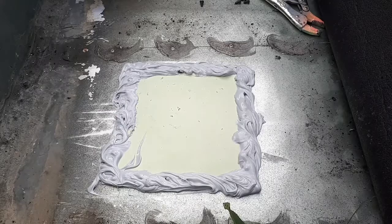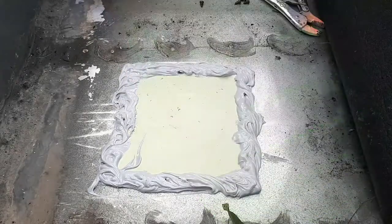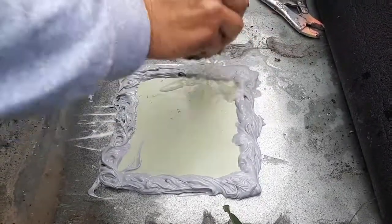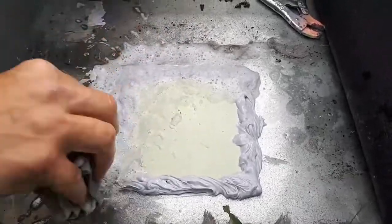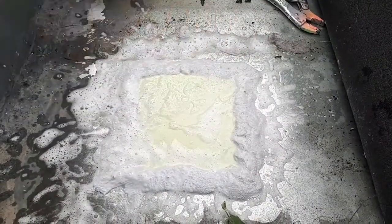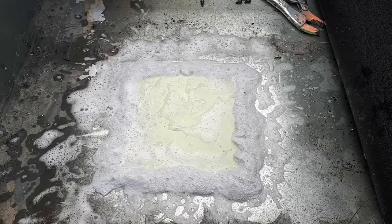Now, how am I going to adjust that? I'm going to take that rag I've been wiping everything down with, more of this dish soap. I'm going to soak that rag, not worry about even keeping it somewhat dry. And I'm just going to tap it down tight around all the screws and seams. Now, in my experience, just what I've done there right now would probably 99% fix the problem. It just looks ugly as sin on the outside.